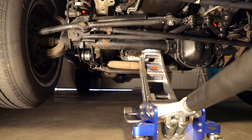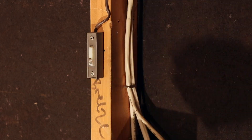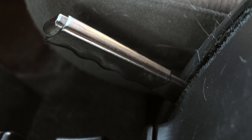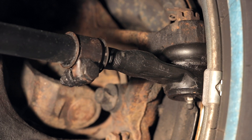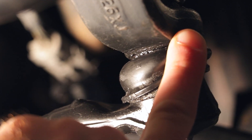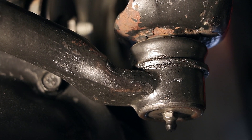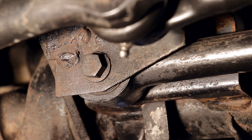To finish our diagnosis, we need to put the vehicle on the ground and run the motor, so we need to open the garage door as well, and you're going to need a partner. With the vehicle back on the ground, running and in park — or with the brake set if it's a manual — begin by having your partner turn the steering wheel back and forth. Look at each of the four rod end joints and examine them for any play. Use your fingers to feel for any popping motions or movement. Pay special attention to the track bar. The joint where the track bar meets the frame on the driver's side is the single most common cause of death wobble if it's loose. Also, if you've had death wobble before, make absolutely certain that the bolt that holds the axle side of the track bar hasn't wallowed out its mounting hole.